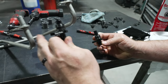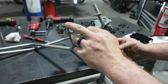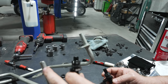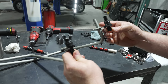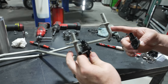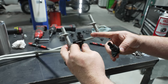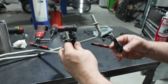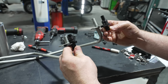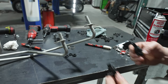Something to take note of: if you look at the tips on the ends of the factory lines, they are different lengths. And the fittings we provide are also different lengths. When these came off the car, they were positioned together — your lines will stay locked together. The short fitting actually goes towards the front of the car, the longer one goes towards the rear. So go ahead and lube up these O-rings and get them up in the transmission.